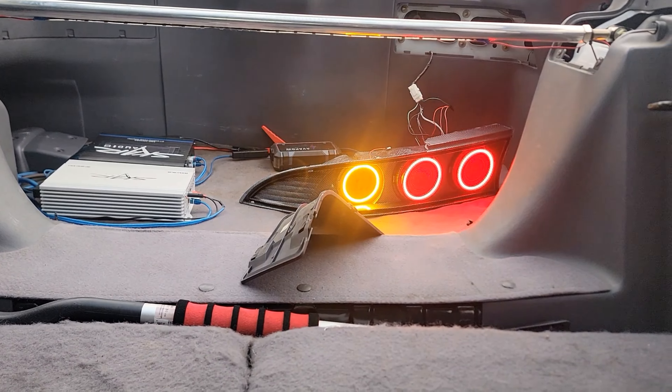You're going to put a wire running from here — this is just a solid brake signal with no flasher. Run a wire into the trunk; it's a yellow wire in my case. What I realized is you're not splicing into this green wire back here, you're adding a wire, because this is a brake signal wire that goes up into the hatch and into that third brake light. You need to make a cut into your factory taillight harness — there is a gray with blue wire.